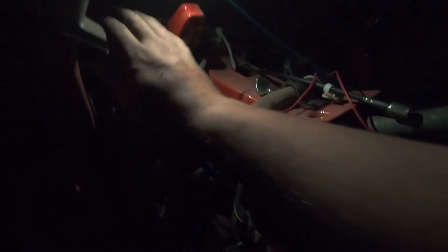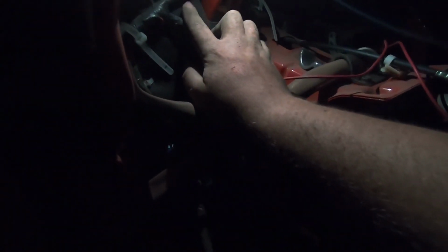There. That's one harness in the car. There's the forward harness. So this controls headlights and signals, anything forward of the dash. And then this piece here is the side that runs all the way to the other side of the vehicle. So this part is where it integrates into the body harness, I believe.